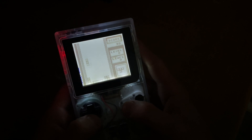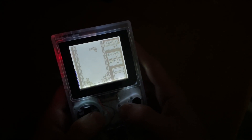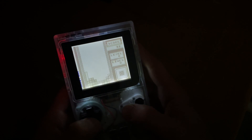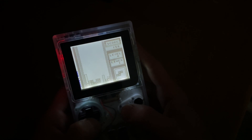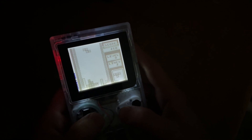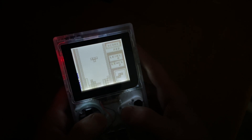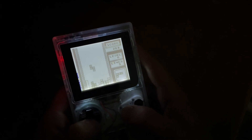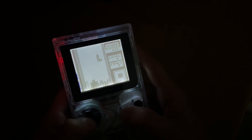Also on the left hand side of the screen, you can see some screen rot or screen decay. This has nothing to do with the backlight mod — it's somewhat common in older Game Boys that have been mistreated, and I'm not aware of any way to repair it. If you know a way, mention so in the comments below. With that being said, the backlight screen — even without the bivert kit installed — is a night and day difference from the Game Boy Pocket's original screen. Being able to play some of my favorite Game Boy games in the dark is a magical experience I would have loved to have as a kid. At under $15 at the time of this mod, I can definitely say this is a worthy mod.